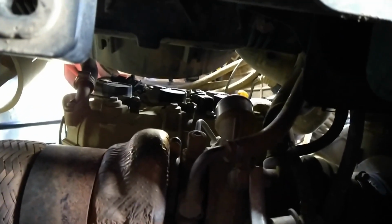And actually, since we're not going to be reusing that old charge tube, and it didn't hurt it anyway, but just in case it does for you guys, I took that screwdriver and pushed right down in the curve of it right there. Just kind of pushed straight down back through here like my hand is, and it made the entire pipe pop off. Be right back with you when we start putting on the new charge tube.